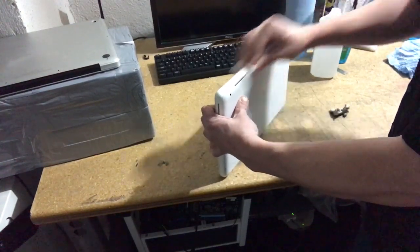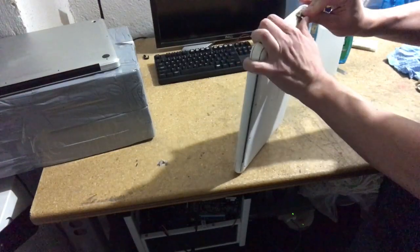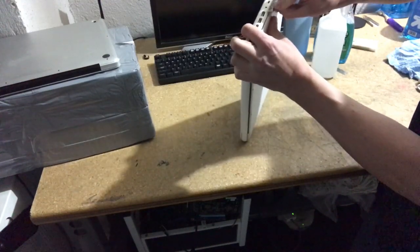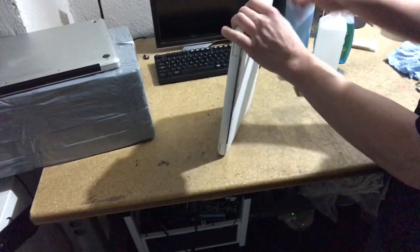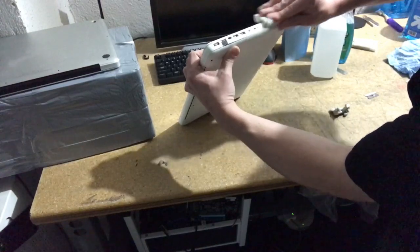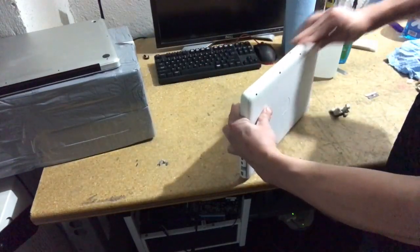It's best if you're methodical about how you do this, just have a specific process so you don't forget any given part. There's some tape here. So what you can do with the tape is use your razor. I don't know how well this is coming across, and just sort of cut the tape off. Again, you want the razor to be flush against the surface. Alright, tape is gone. There's still tape residue there, so I will use the Magic Eraser. Works wonders on that. There we go, and it's just like there was never tape. So I'll keep going along here.